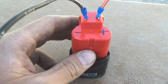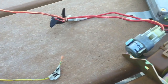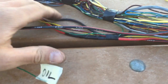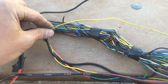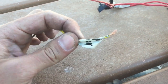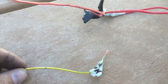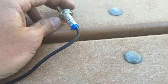That's our battery connection. Now here's the engine grommet that goes to the left — we follow it and it T's right here. This was our ignition-on setup. I just peeled away some of the insulation and I'm going to touch it right there, and it's going to act as if I turned on the key, so things like our VSS sensor will trigger.